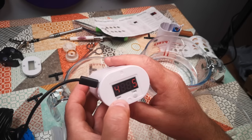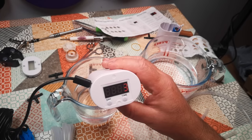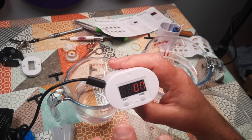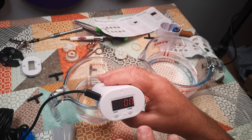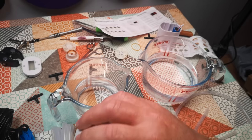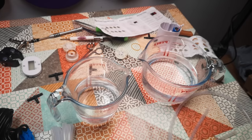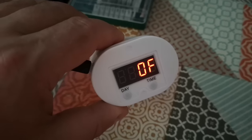We'll also test whether it will pump when there's nothing to pump — and it will. I think, as somebody noted in the comments, the whole idea of it having protection against loss of water is actually just a statement that it doesn't explode — the pump still runs but it pumps air instead. I don't think it's actually got a sensor to detect that the water's out. Interestingly, when it's fully charged it really does say 'of' on the display — I thought that was a typo in the instructions but apparently not.